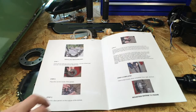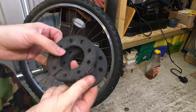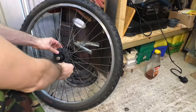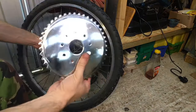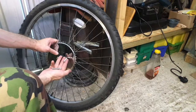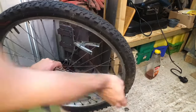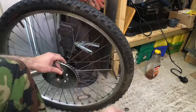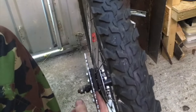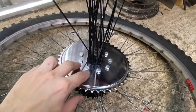The first thing in the manual says to attach the rear sprocket to the wheel. With these rubber rings, you need to cut one of them because that one goes on the inside and needs to go around the hub. The other one goes on the outside, which protects the spokes. Then the sprocket goes on top of that, and the bolts go through with the heads on the outside. You put the bolt through, then the lock washer, then the nut. You've got the sprocket, then the rubber, the spokes are in between the two rubbers, and the metal bracket on the back.